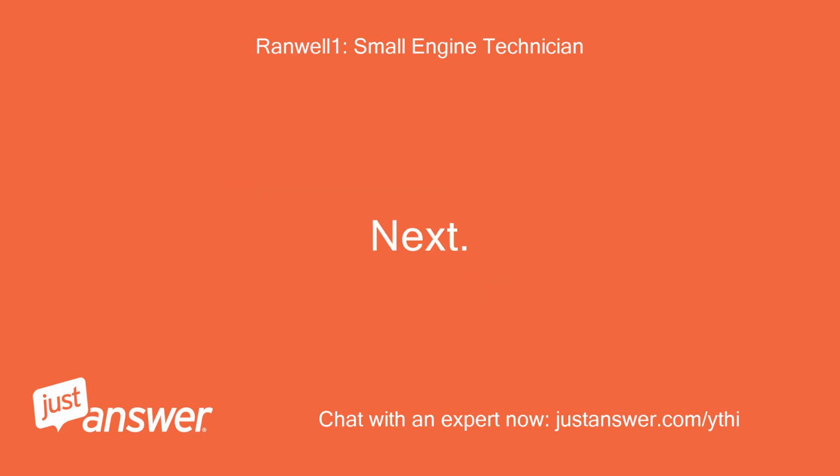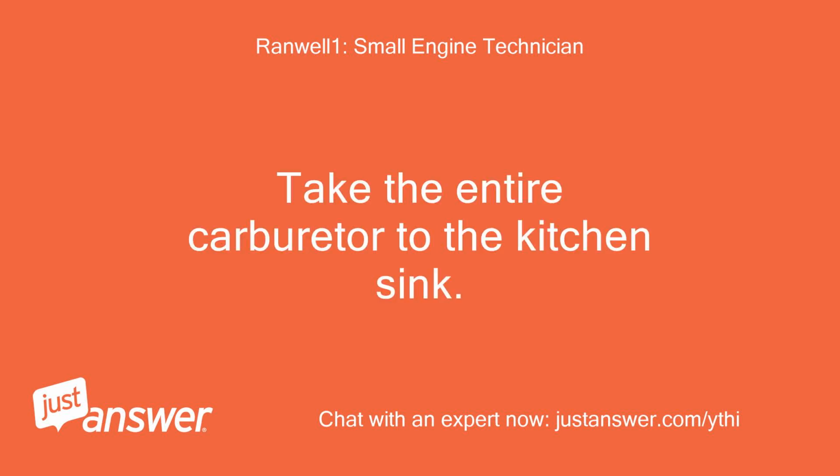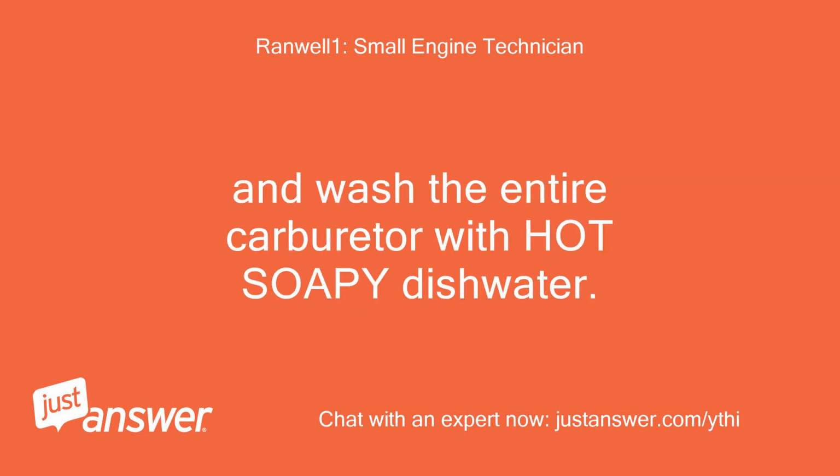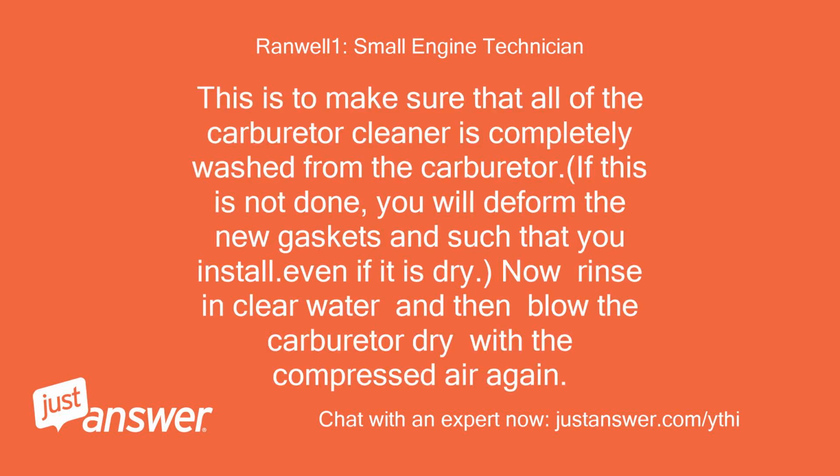Next, take the entire carburetor to the kitchen sink. Okay, maybe it would be better to get a big bowl, so you don't make your wife mad. And wash the entire carburetor with hot soapy dishwater. This is to make sure that all of the carburetor cleaner is completely washed from the carburetor. If this is not done, you will deform the new gaskets and such that you install. Even if it is dry, now rinse in clear water and then blow the carburetor dry with the compressed air again.